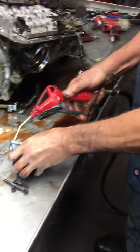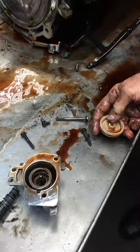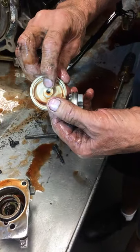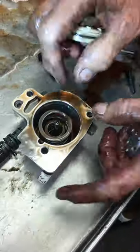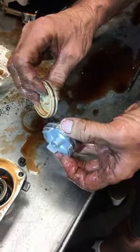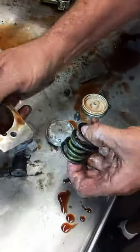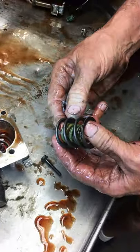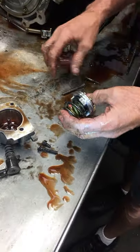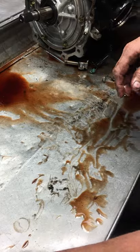These transmissions, when they come out from GM — GM can't get away from plastic. So when we rebuild them back, we always go with an aluminum piston, because these pistons will break where the pin goes and slides up and down this shaft. We go with an aluminum billet piston which gives you a longer shank and more support to keep the piston from rocking as it slides up and down this bore. And these are the springs that soften the shift. By changing these springs, you can get a lot firmer shift, and then of course by adding the Corvette servo.